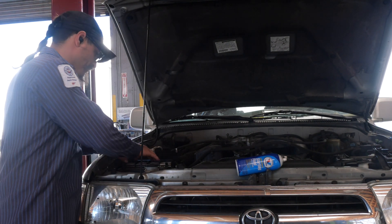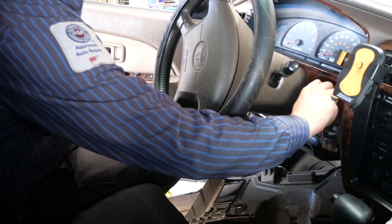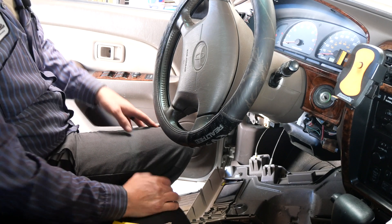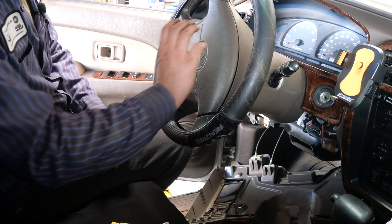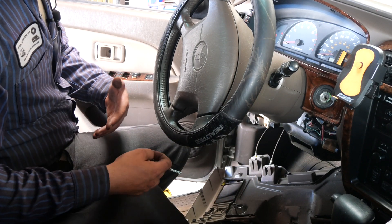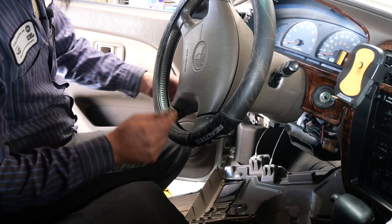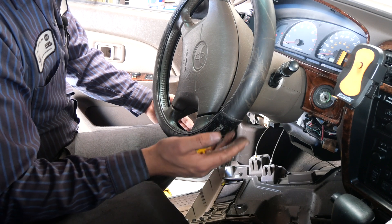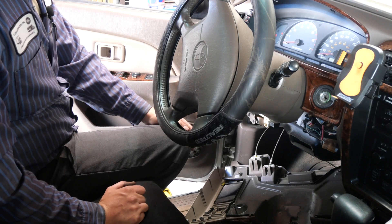Now that we're assuming this is fuel related, the next step is to get to the fuel pump. On this particular car it's right here on the bottom. We want to make sure we have power going to it and power going through it when we cycle the key. On most cars, when you cycle the key to the run position without starting it, the fuel pump primes for a bit and then the fuel pump relay shuts off. Probe the outlet side and verify you're getting power in and power out the load side.